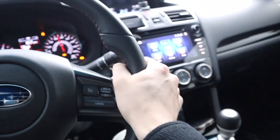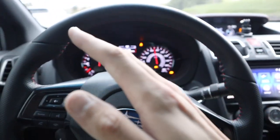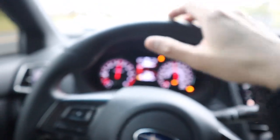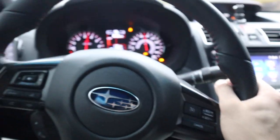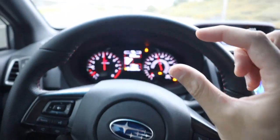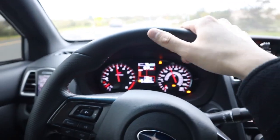One thing I forgot to mention was the axle bind. So on the WRX and the STI, since it's all-wheel drive, you cannot put that much camber on the front of the car. It's kind of happening to me sometimes. When you ride really low, the axles will bind because as you lower the car, the axles kind of tilt in more. It's recommended to drive at a higher ride height to prevent axle bind. Once it starts driving a little bit lower than usual, the steering wheel actually starts to shake, and you'll be able to tell when you're driving the car.